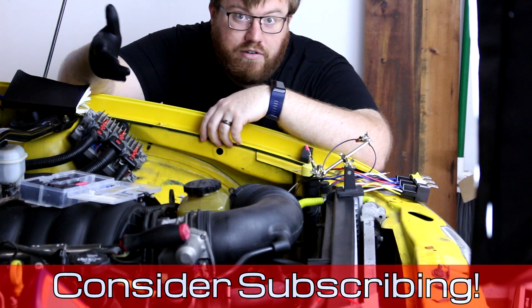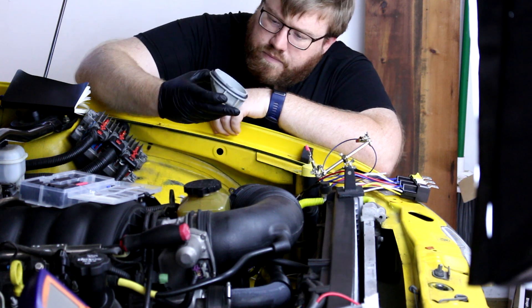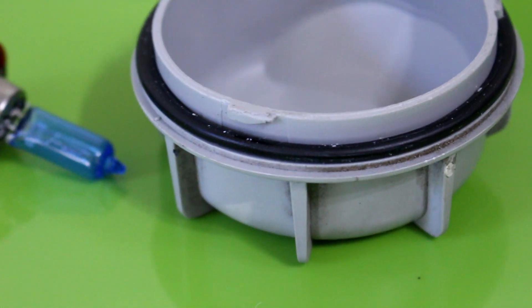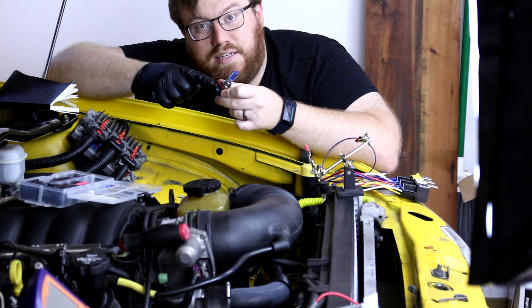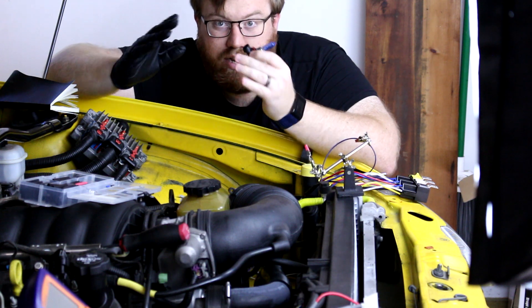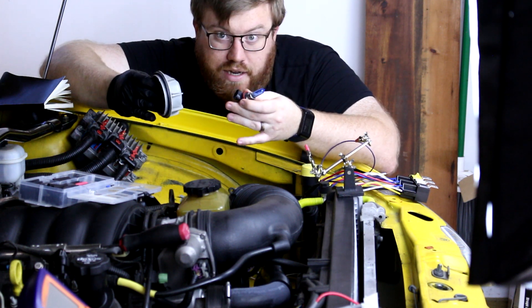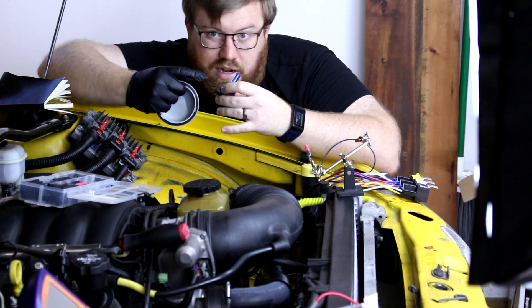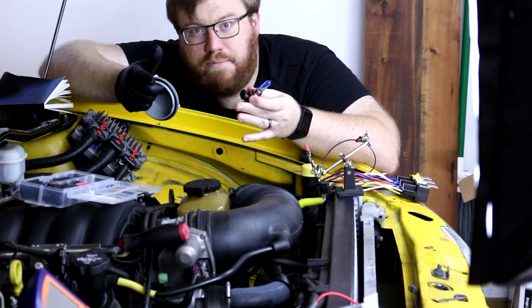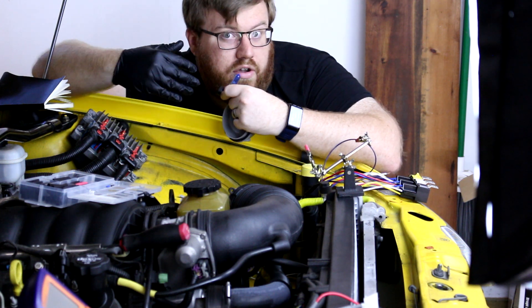You may recognize this car as the GTO from that previous video. I used the bulb grease the way I recommend on this car, so let's check it out. The headlight housing cap gasket still has some of that grease on it. The bulb is still good, the gasket is still clean, and most importantly the contacts are not corroded. You can put bulb grease directly on the contacts and won't run into problems as long as things are ideal — and even if things are less than ideal you can still get away with it sometimes. I'm going to continue not doing that, because the amount of air that gets into that chamber is very minimal and won't cause the kind of corrosion that would affect the bulb within its lifespan anyway.